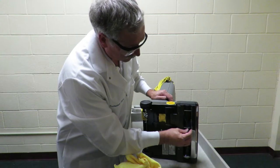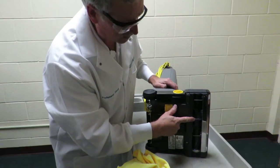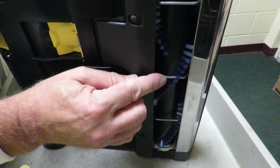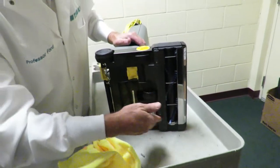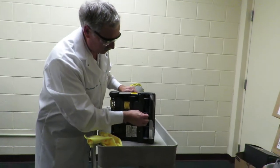Your brush should always be sticking out past these guide bars. If you notice these guide bars right here — let's get a close-up of that — make sure your brush is sticking out past the guide bars. If they become flush with the guide bars, then the brush is no longer making contact with the carpet. So it's time to change the brushes.